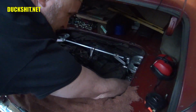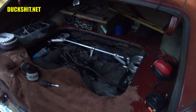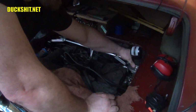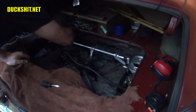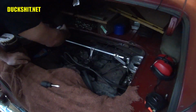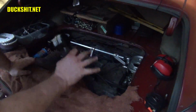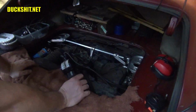Bring this one up just a little bit. I don't know if you can hear it, but the idle speed came up just a hair. Alright, we got about 8 1/4 now. And we got 8 1/4 over here. They are now effectively balanced at idle. I'm not going to play with the mixture screws in that because I think that they're fine as they are.